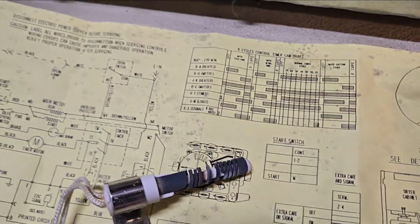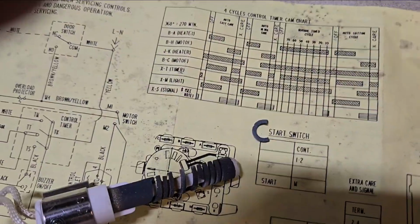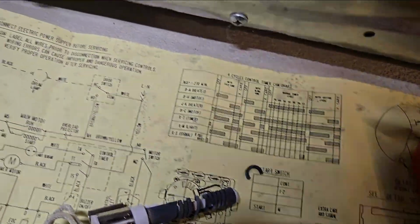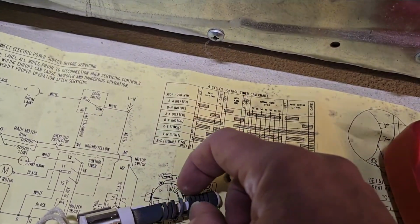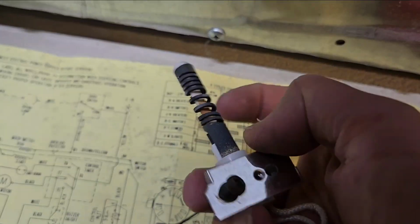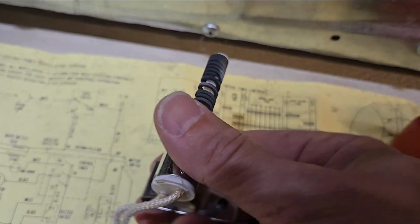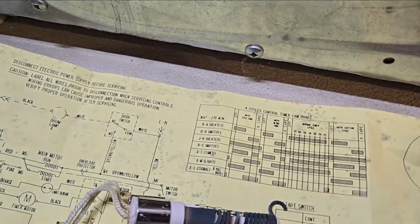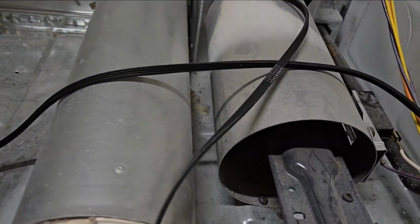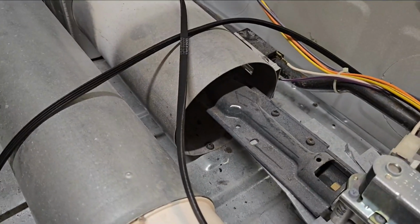I'm gonna check out if I can find the other part still lying in there. So I did find this little piece here, and I think there are other fragments in there of this heating element being shattered. So yep, I need a new igniter, and maybe then this dryer works again, because otherwise it's in a great condition here.